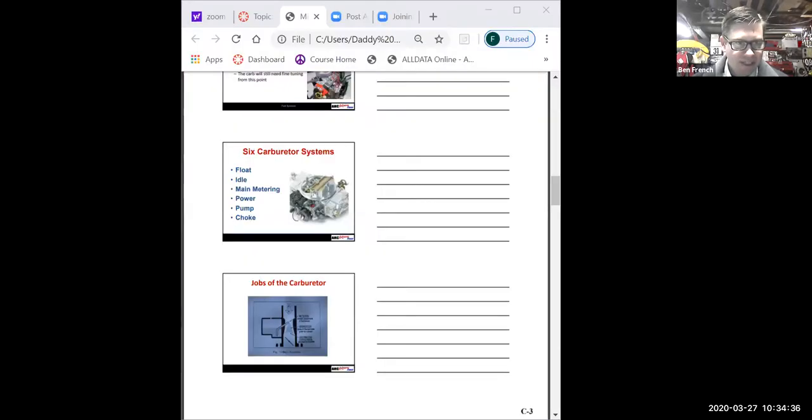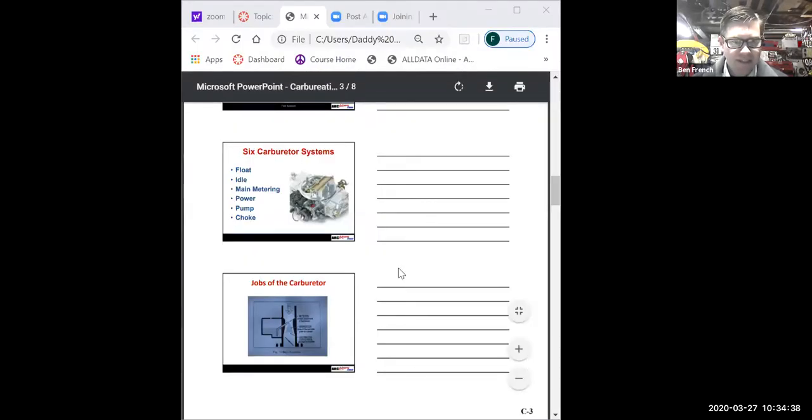Interesting. So they came up with 680 CFM and then a lot of 750s. Let's go back. And I'm gonna change this to stock. And let's see those results. Okay, there we go. Now we're getting back into about 600 CFM range. So you can kind of see how their selection thing basically does follow that same formula.